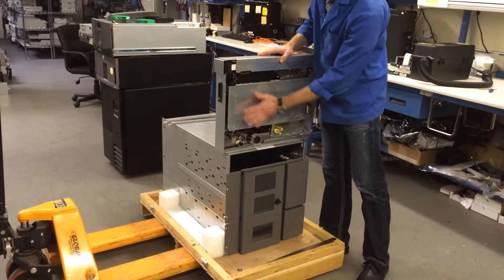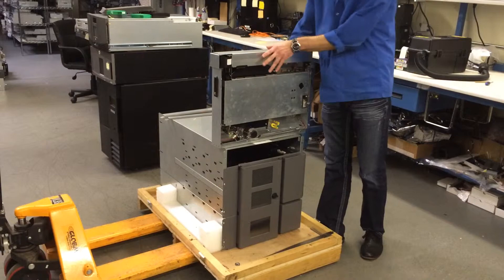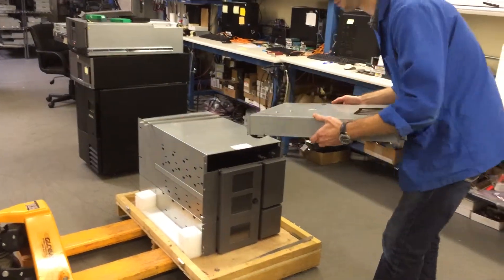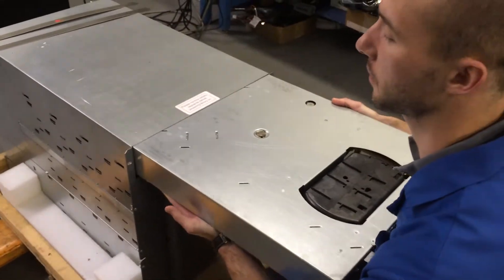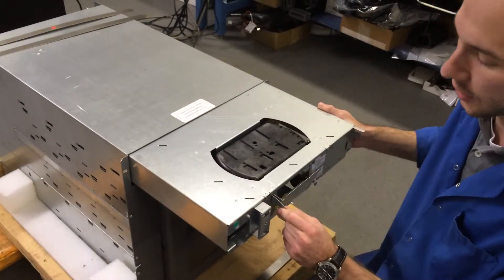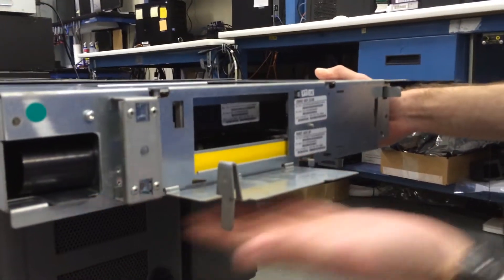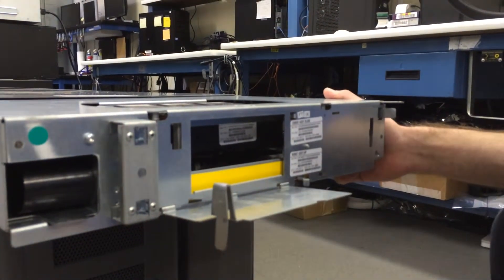Just again, go over, make sure everything is fine, nothing is sticking out, nothing inside the library is interfering. And you just flip the picker to this position and start slowly installing inside the library. Once you're kind of midway through, make sure that you open this door. It's very important that this door is completely open, flat, in this position.